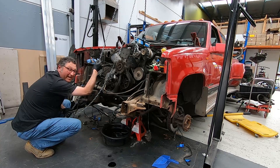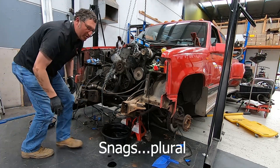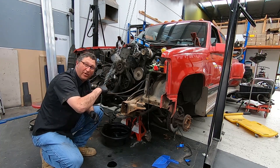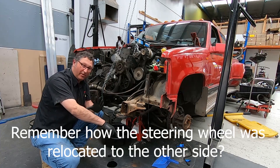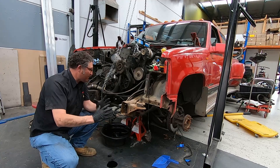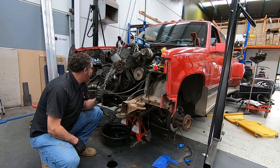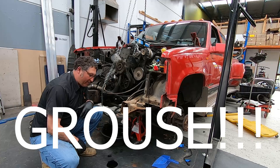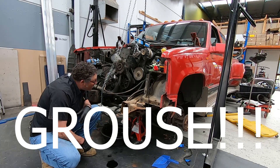We have a major snag. Because this has been converted, the steering column is going between the turbo and the actual dump pipe, so it's going to want to come around the column. I think I've got to pull the pipe off the back of the turbo before we can go any further. And I've got a leak. Fantastic, let's go.